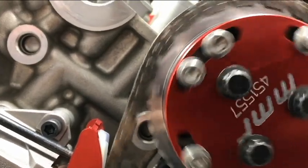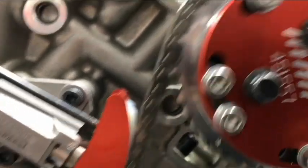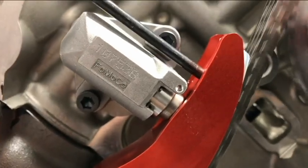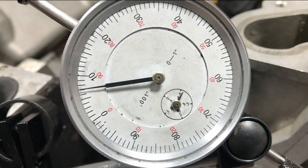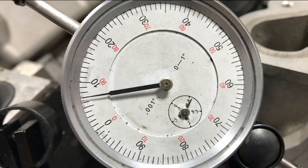In the second video we've replaced the factory gear with MMR's new perfect circle gear. The difference is amazing. We've now fully stabilized the tensioner movement, creating smooth rotation and completely removing the stress from the tensioner. The list of advantages are long, but include vastly improved primary and secondary tensioner life, vastly improved primary and secondary chain life, smoother and quieter operation, and reduced harmonics.